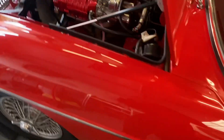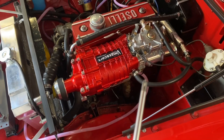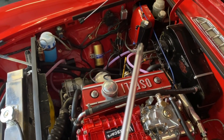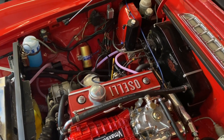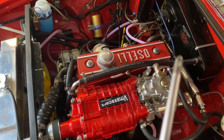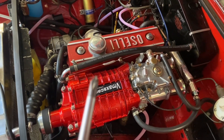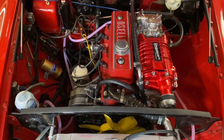All back together — just about to put it on the rolling road. You can see the tubes connected up for the charge cooler: the charge cooler radiator is there, charge cooler pump is there, charge cooler reservoir is there, and these pink hoses are silicon hose with anti-freeze in it. We've replaced the metal hose on the top with just a rubber hose going to the heater, because the metal hose gets in the way — it's a pre-bent shape, difficult to manage. I think that's everything — I'll just start it up so you can hear it.